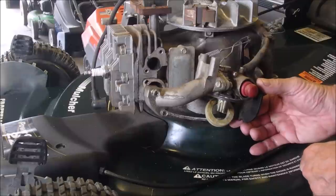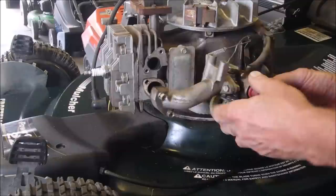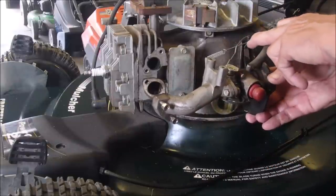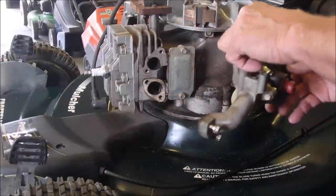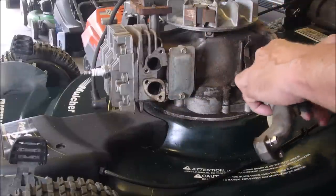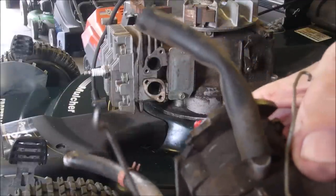for the throttle. So the top one is the one with the hook in it, and it goes to the closest hole on the carburetor right there. And the bottom one is the one with the spring, and it provides you that return that you need on the governor. So this one is a half of a hook, and this one is a bit of a Z-bend, eh? So this one has a bit of a Z-bend, and that's the one the guys hate right there.